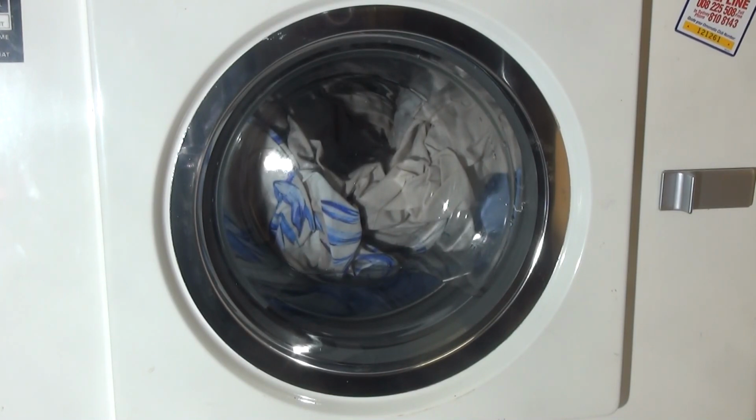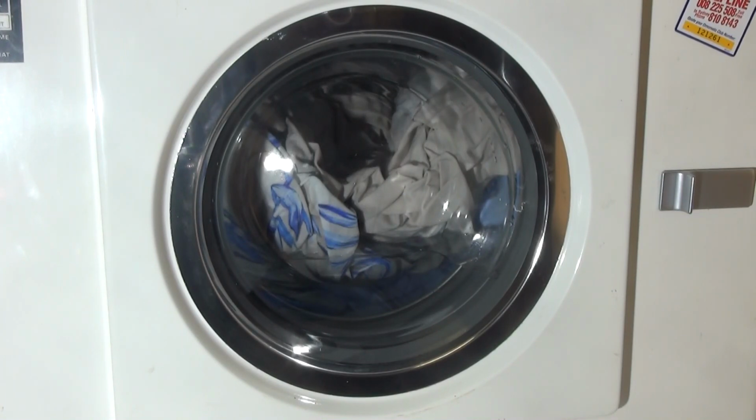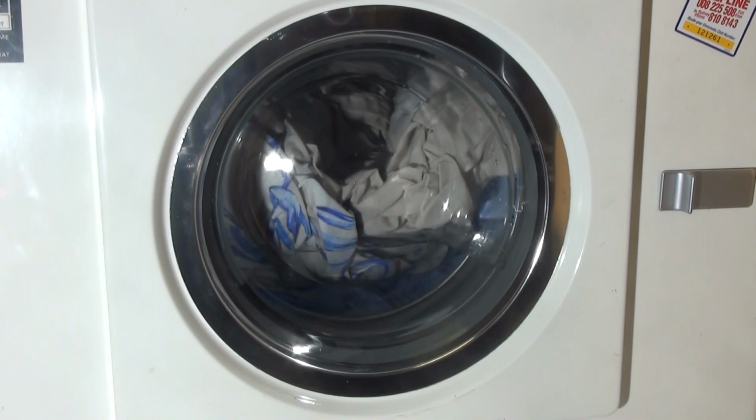Yeah, or if it does what the minimum iron time does, where it boosts up to 1300 for a couple of seconds and comes back down to 1200. So, right, where the water cycle levels off at 1200. Because what I do know is that denim cuts out the intermediate spins. It does. That's why I no longer use the denim cycle for jeans, because the lack of spins was producing poor rinses. So I just stuck it on automatic. And I use automatic for woolens because...